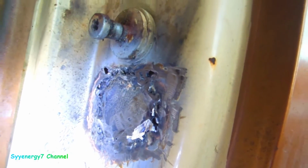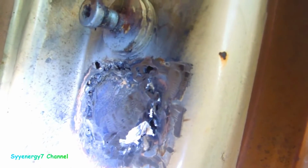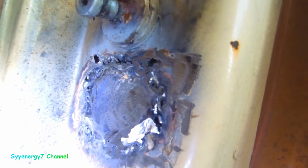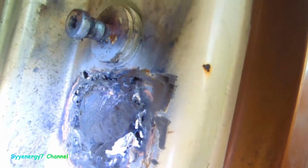There's some little holes here, but there's a plate behind it, and we're going to fill that up right now. I chemically cleaned it with starting fluid and blew it off with air. I'm going to do that again before I put on panel adhesive, because the panel adhesive will stop any kind of water. Actually, that's a pretty flat panel. I'm surprised. That did come out okay.